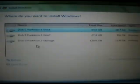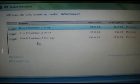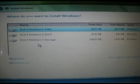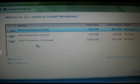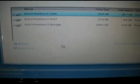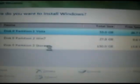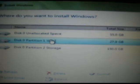Now, normally if you're installing on a fresh hard drive without anything installed on it, it should just have one option here, which will be disk 0 partition 1. Now, because I already have my operating system installed on the computer, that's why it has all those partitions. So what I'm gonna do is to delete everything by going to drive options, and I'm gonna delete each partition one by one. I already backed up my hard drive, so this is not gonna be a problem. Delete this one.